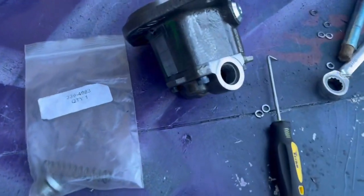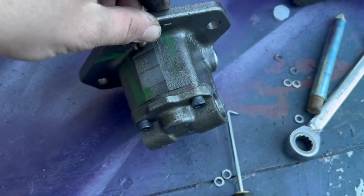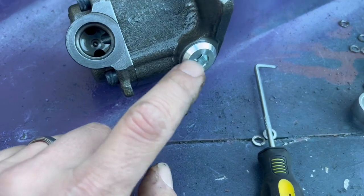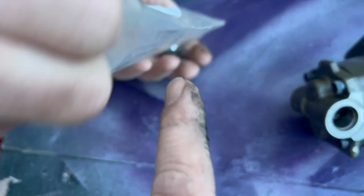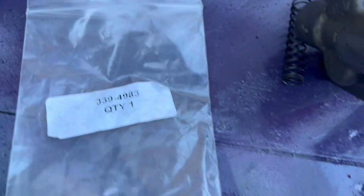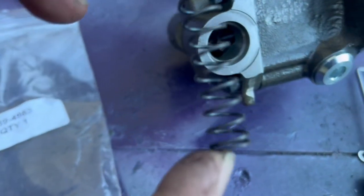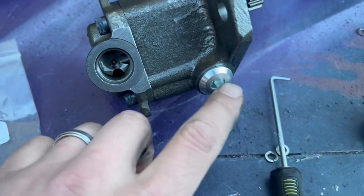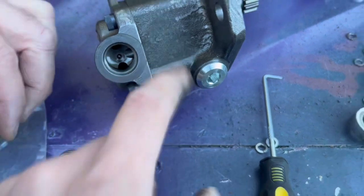We tested my fuel pressure and were only getting about 75 to 80 PSI, which is not enough — Cat likes to be at least 100 at 1500 RPM. So I bought the upgraded transfer pump. If you have a Cat and you have this Allen key bolt right here, you can buy this upgraded spring. The part number is 3394983. It's a longer spring that goes in this spot right here, and that bumps up your fuel pressure.